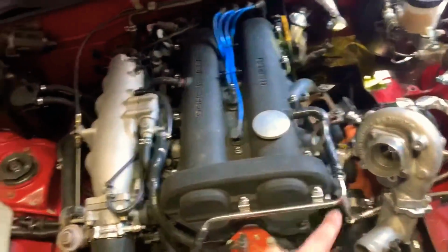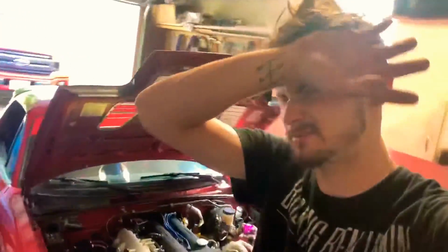But yeah, and then I got to put an air filter so it ventilates to the air on my oil catch can, because I feel like the way I have it run up through this, it's causing some slight positive crankcase ventilation or something, positive pressure, I don't know. But I think it's just causing too much pressure in the valve cover, so therefore I'm going to just drill and tap my little K&N bleeder. I have, it's like a 3/8 tap or something, 5/8. So I'm not too worried about it. It'll tap right into the aluminum, and I won't have to worry about that because it's ventilated.